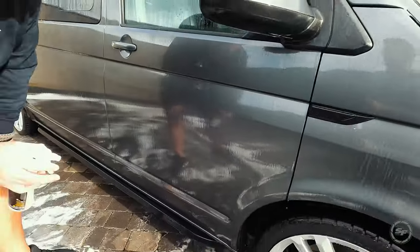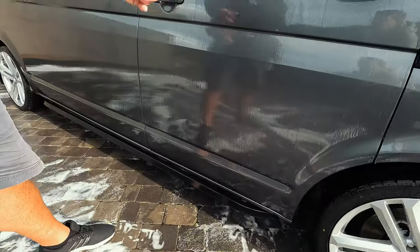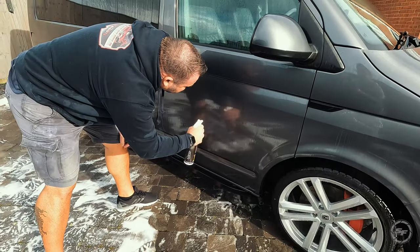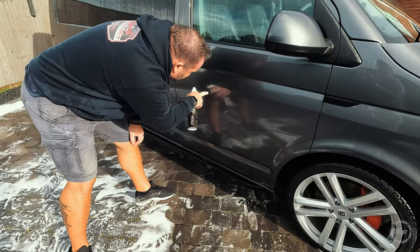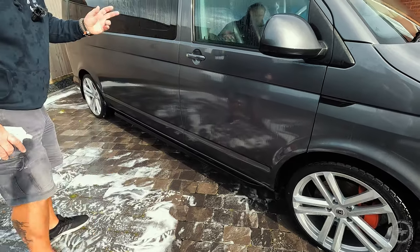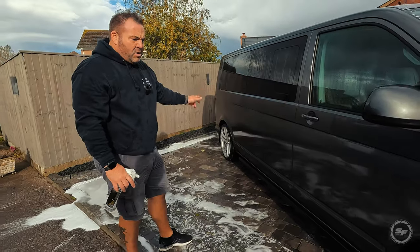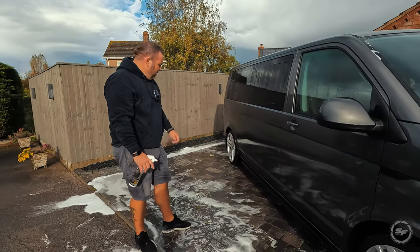That's it. Yeah. It is. So it's a real metallic-y smell. When it is put on dry, it'll start to break down. You'll see it start to bleed, but yeah, I can see quite a few of these spots of tar all over. So what we do is we'll go around and grab a microfiber, and we'll just give those a gentle wipe over. And then we'll wash the vehicle afterwards and put some fallout remover on as well.